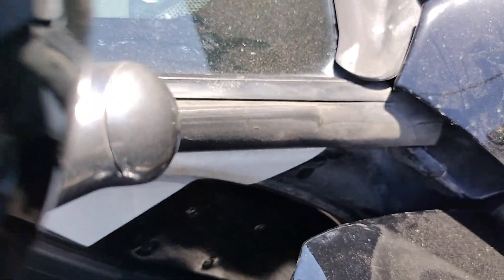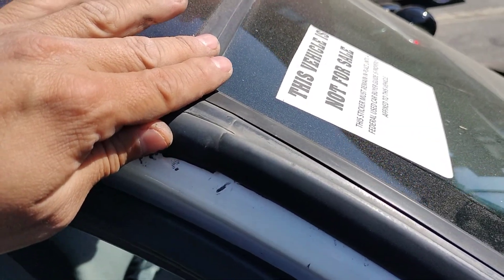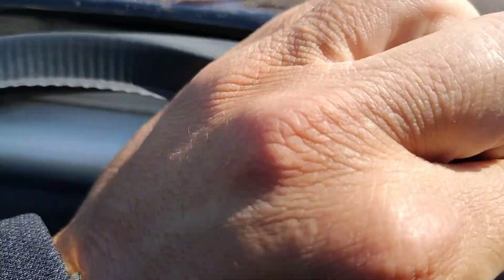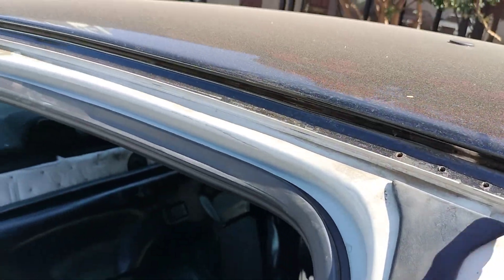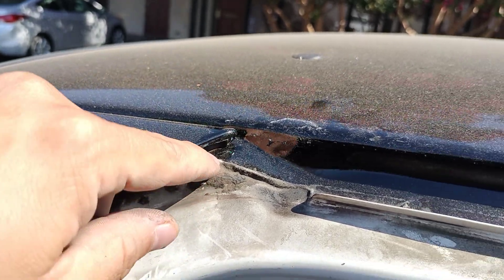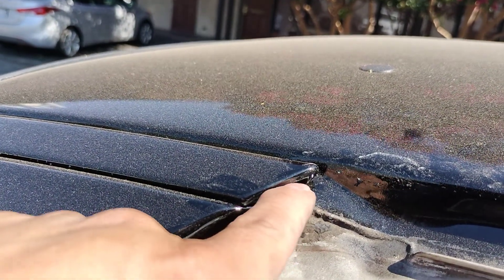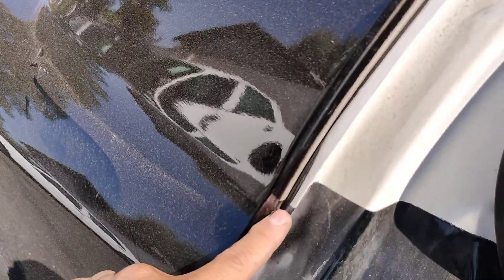Here's the bottom part of it. There's the top part — the windshield wiper part of your front windshield. And from there it's the same thing. There are holes where this is going to sit — just follow this piece all the way until you get to the very far end. On the very far end you're going to have this little area where there's going to be an extra piece, an extra little rubber seal that's already in the actual molding. It doesn't clip — it just gets flushed in there and then you bring down the rest.